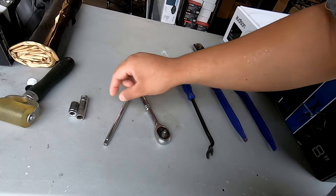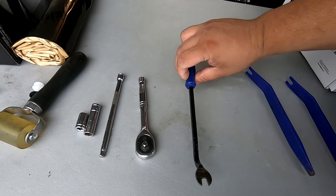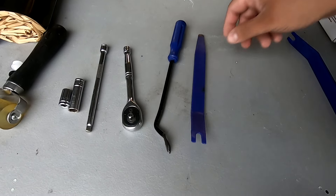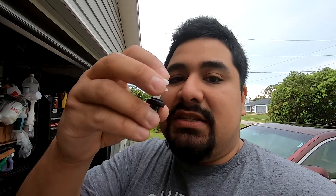You could kind of get away without a trim tool but I grab one of each just to be safe. Along with the tools there might be two other things you want to pick up: retaining clips for your C-pillar. These are what secure the C-pillar to the car. When you remove your C-pillar you squeeze these, and putting them back to normal is annoying, so buying new ones might be easier — you can find these on Amazon with the link in the description.